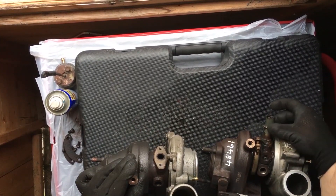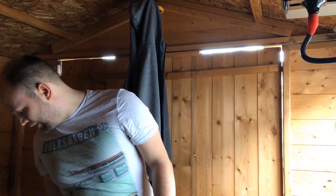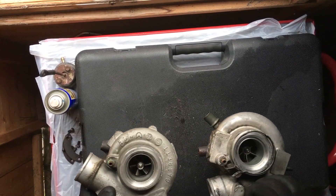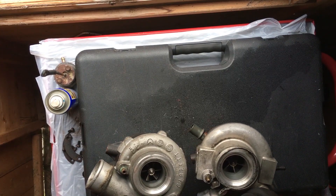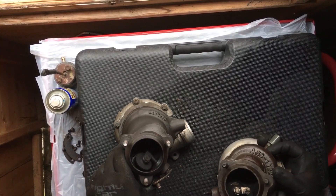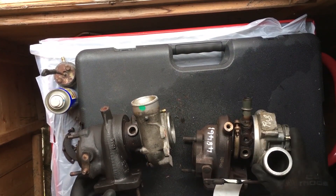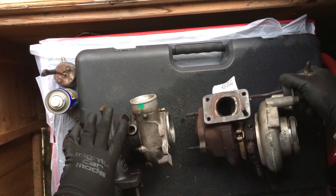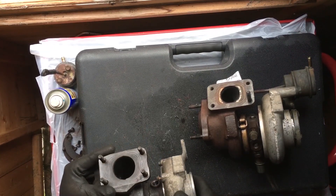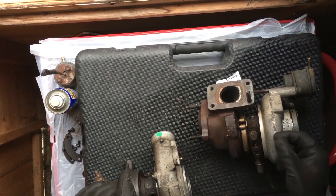The cooler parts are in the same place - I do believe the coolant pipes are bigger. I have the old parts lying around somewhere. When I find them I can compare to the original and go from there. The inlet side pretty much looks the same. I measured it - that's absolutely fine. The exhaust looks the same size as well - the recommendation is still a 3-inch downpipe for more power, so we'll definitely be taking that opportunity. All the coolant and oil lines seem in relatively the same places. I don't think I'm going to have an issue. The stud bolts are in there so I'll have to take the original ones off and put them onto the new one - that shouldn't be much of a task.